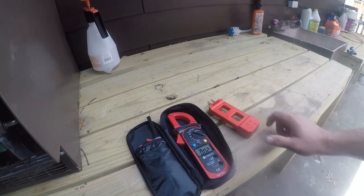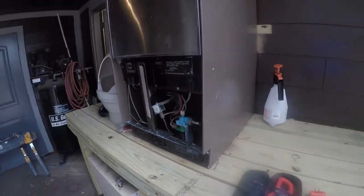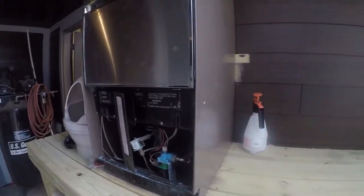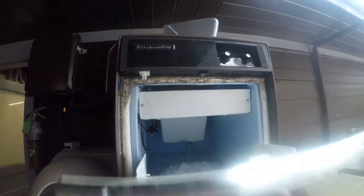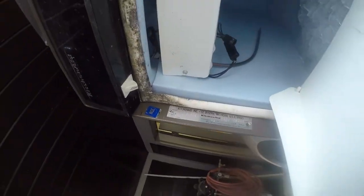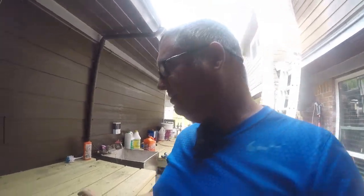At $25, or about $40 for the set, that's cheaper than buying it at a big box store. We're going to use my ice machine as our test subject — there's a repair video about it on this channel. The nameplate on the back rates it for 5.3 amps. Let's see what it really draws.